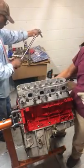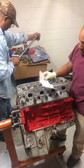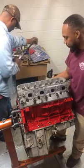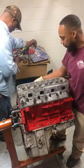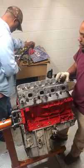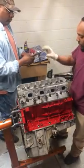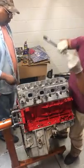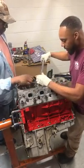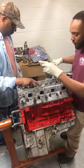Now we're going to go for our final pass with bolts 1 through 10 at 80 foot-pounds. And this is what you do without having to do degrees — if you ain't got the degree tool, just use the torque. ARP doesn't give you the degree spec. All right, we're doing 1 through 10 at 80 foot-pounds. Let's go.